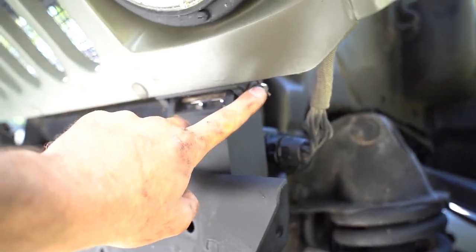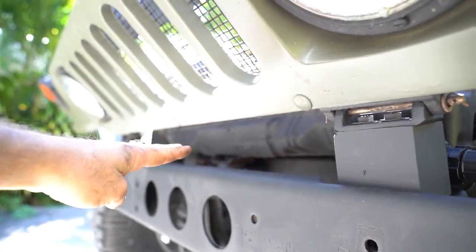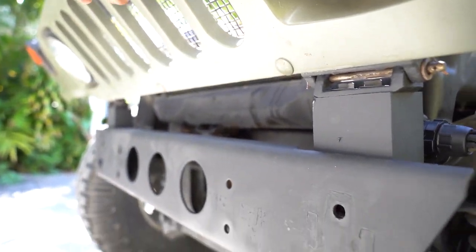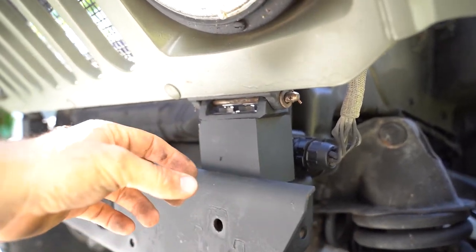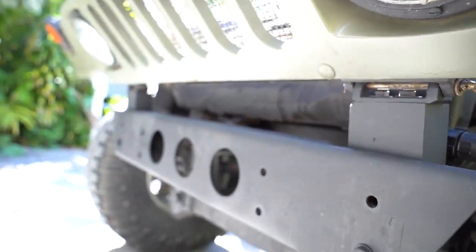You can take these little hinge pins out and slide the hinges out. I had a jack under there with the hood down and I jacked up the front of the hood, lifted it up, slid these out, took the bolts out, put the new blocks in, slid it down, bolted it up, and that worked great. I spray-painted them black.